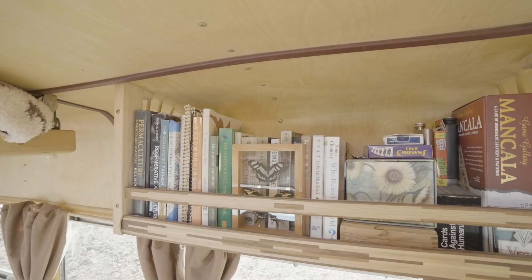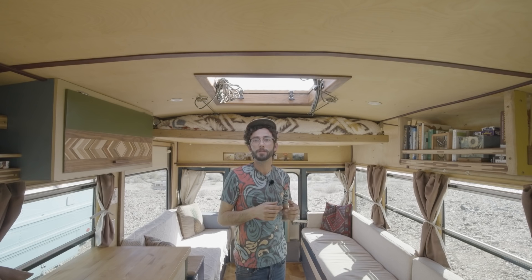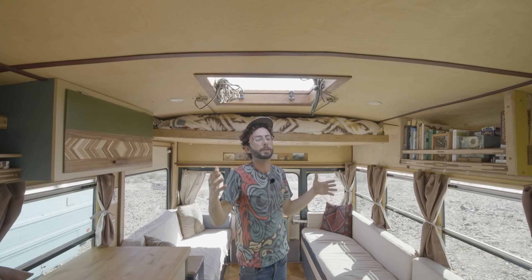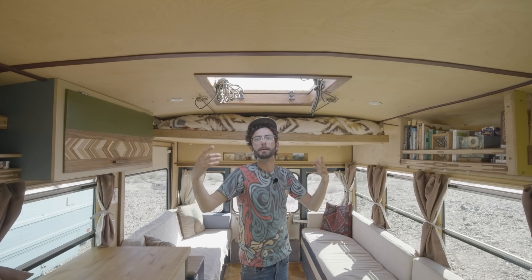Our bus came from Oregon and it had the regular bus escape hatch right here that was so obscenely rusted — when we pulled off the ceiling, it was just orange and black streaks all over. We thought about modifying it and putting in a cool circular window. But in the end, we just ripped the whole thing out and built one out of walnut. Building something weatherproof from scratch is pretty challenging and frustrating, but we used a lot of Gorilla Tape and clear silicone and did a lot of overlap in the design on the exterior. It doesn't leak — we've been through a really rainy winter and so far so good.